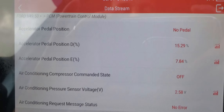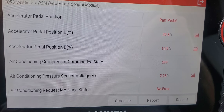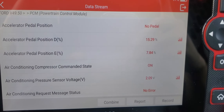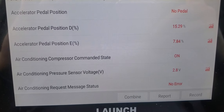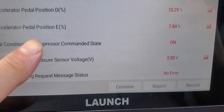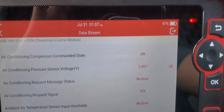There are so many parameters I'd need five hours just to go through all of them. I'm going to select a few. See — I accelerated it and everything moves. The air conditioning command state is off right now; now it's on because the AC compressor just turned on. When the compressor is off it says command state off.